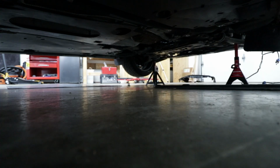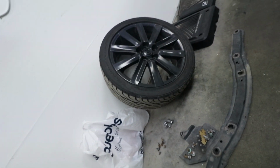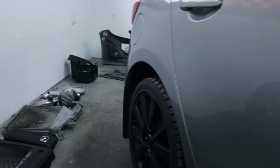Now I believe we have to really get in there at the downpipe. I just did a ton of work off camera here because I was in the zone. So obviously you guys know that we removed the cross member last. If we get up under the car again, this midsection right here has another cross member that has 8 bolts in it. That guy over there. So we took that out.